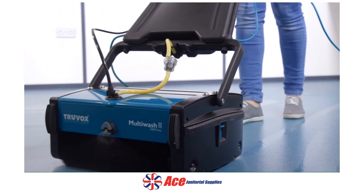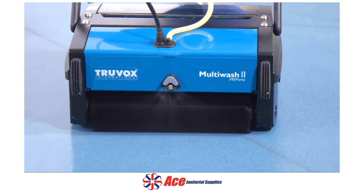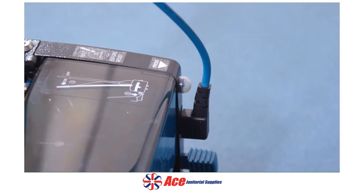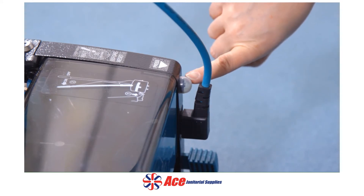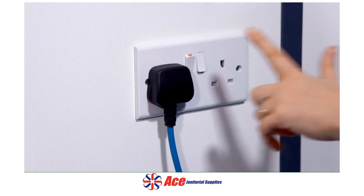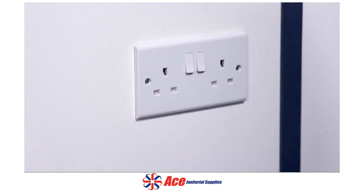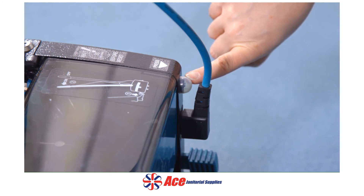In the event that the motor is overloaded due to either improper power supply or an unexpected obstruction to the brush or drum rotation, the overload protector trips and protects the motor from any damage. If this happens, unplug the machine and identify the problem. Once corrected, plug the machine into a socket outlet and reset the motor overload button after a minimum of 30 seconds.